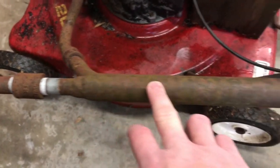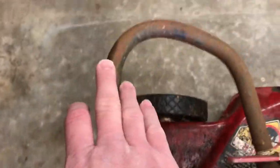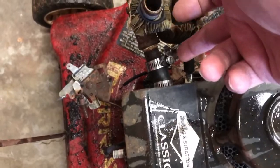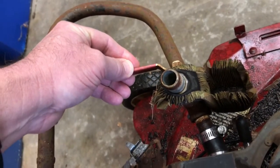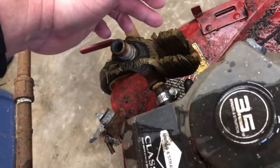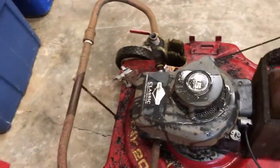That's what this right here is — the fuel plasma reactor. From there, after it goes through the reactor, it goes right around here into the intake port. The intake port of the little engine right here has another ball valve that allows you to bring in some fresh air. One time I had an air filter on here and now you can see that it's just about rotted away. So that's the intake side of the system.